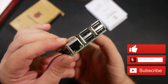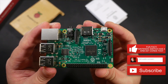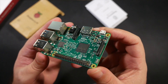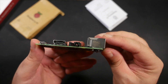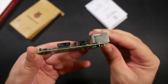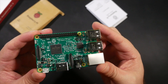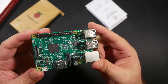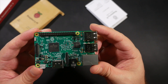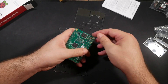The processor inside is a Broadcom BCM2837 ARM Cortex-A53 quad-core running at up to 1.2 GHz. There's also 1GB of RAM on board, a 40-pin connector for hooking I/O into other hardware, and connectors for things like the Raspberry Pi camera module — sold separately — and it can also support a special touchscreen display. For basic accessories there are four USB ports, a standard audio jack, audio over HDMI, a 10/100 Base-T Ethernet port, and it even has 802.11BGN Wi-Fi and Bluetooth 4.1 including the low-energy specification.